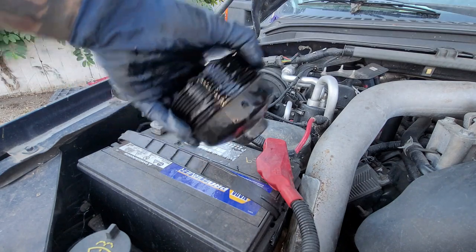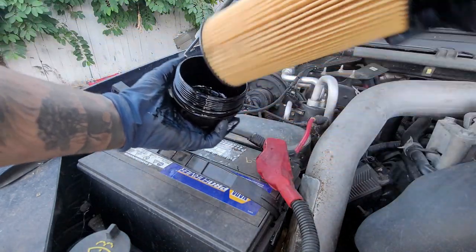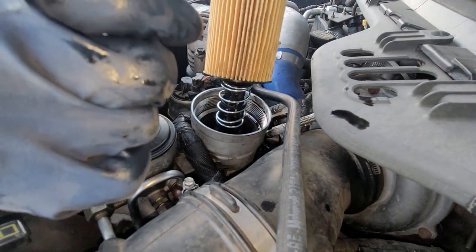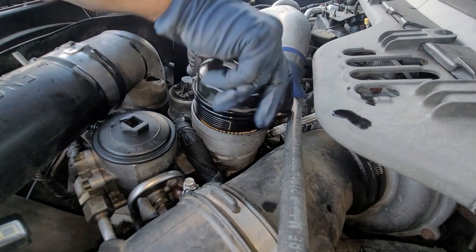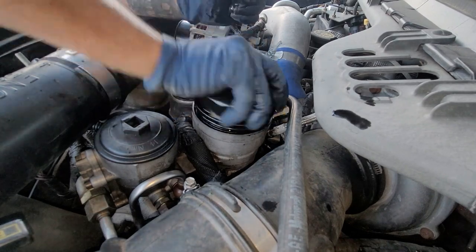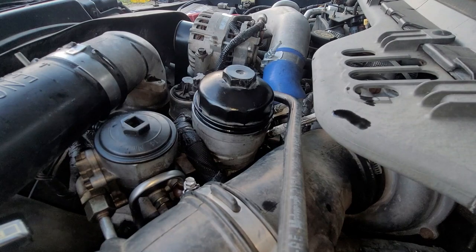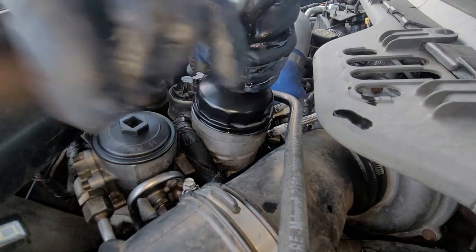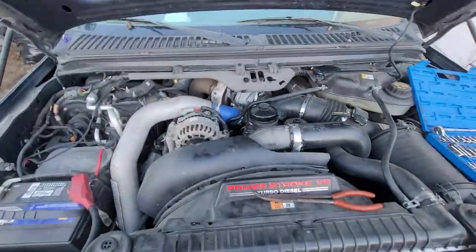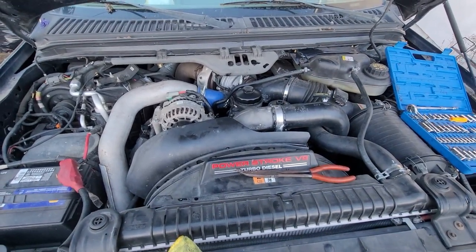Make sure your o-ring is not spun like mine was earlier — run your fingernail around it, get some oil on that, and get it right in. You can see how much smoother that feels. Go ahead and put in the oil filter — this should seat right in, should fit pretty smoothly — there's a little spring load going on. This should be torqued down to about 18 foot pounds. That's pretty much it — if this video helped you out, give it a thumbs up, comment below if you have any questions, and hit that subscribe button for more upcoming videos. Thanks for watching.